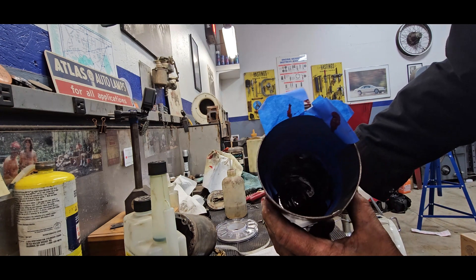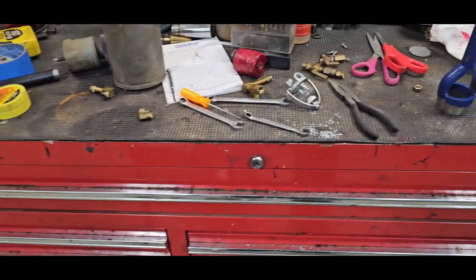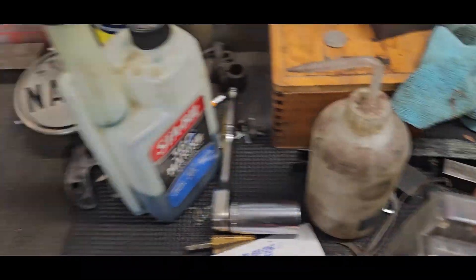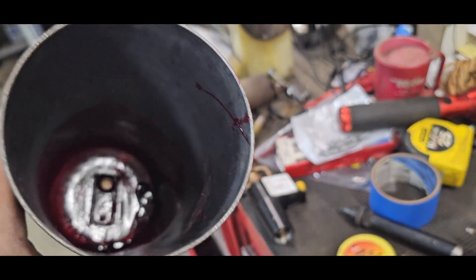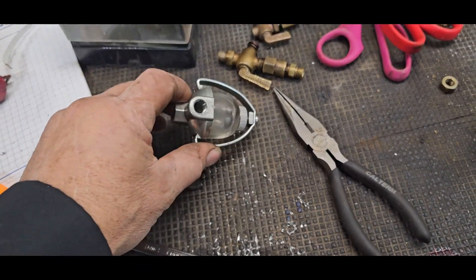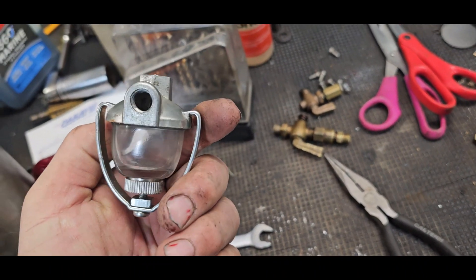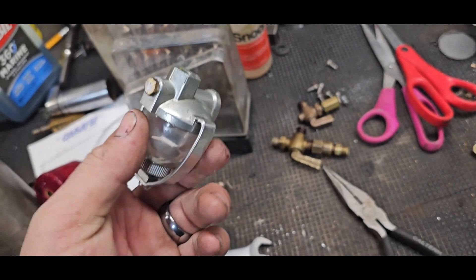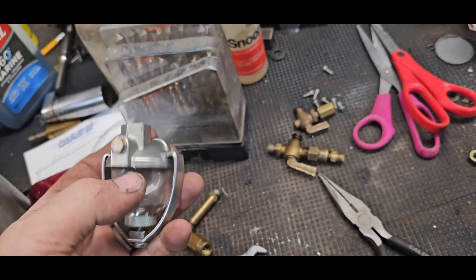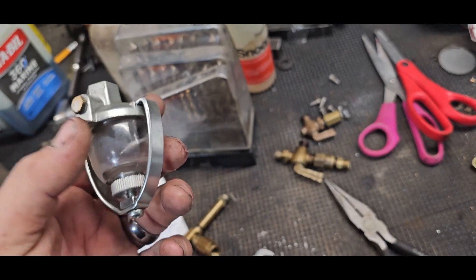New day - let's see if I can remember how to put this mess back together. Yesterday I drilled out the passages in this - this is for like a lawn tractor amount of fuel flow and it wasn't sufficient, so I blew out the passages. I'll get rid of the on/off valve - it's no longer needed, there's one below it on the can.